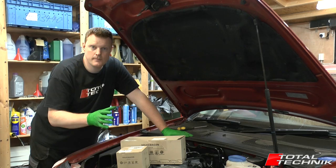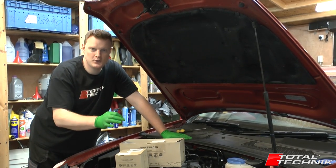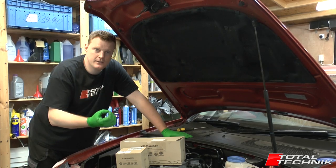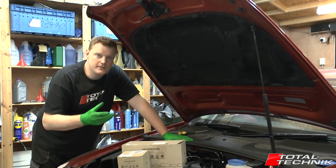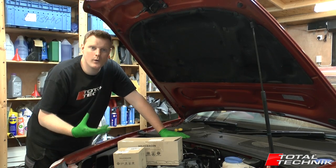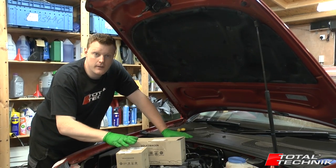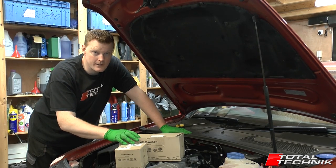Things like a flashing glow plug light when you give the car a boost of acceleration can all be attributed to timing being slightly off. The timing on these can actually be fine-tuned. There's a piece of software called VCDS, also known as Vagcom, which is excellent for helping you fine-tune the cams. Towards the end of the video we'll show you the settings for each of the two cams, so you might be able to make adjustments using VCDS rather than doing the whole cam belt change. Make sure you watch this video in its entirety before getting stuck into the work.